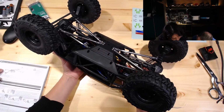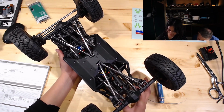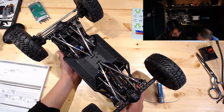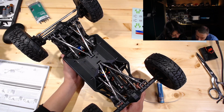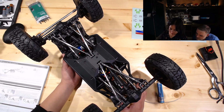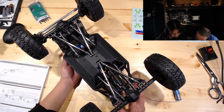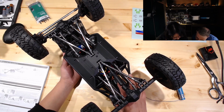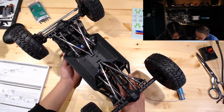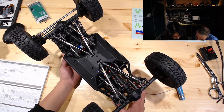Move the throttle stick to the neutral position and press the set button. Okay, so hit the set button. Move the throttle to the end position for forward. Okay, so that's full blast, so hit the set button. I didn't hear it bleep. Do you have to hold it? Press the set button again? Okay, that's fine. Yeah, it did not beep twice.